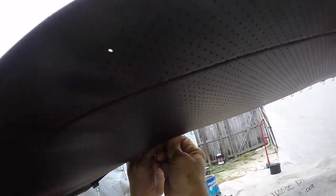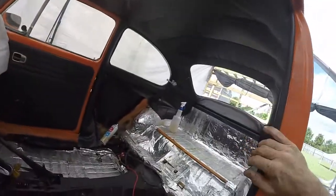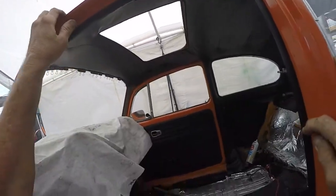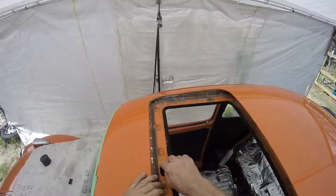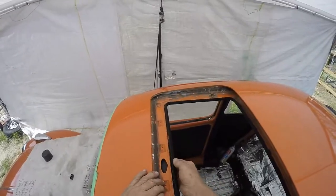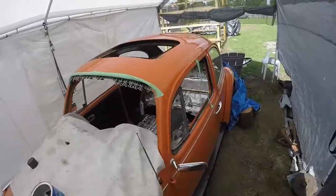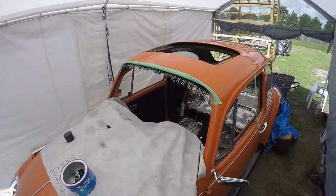Next time, someone else can do the glass — too much for me nowadays. I am really happy with this: dome light in, oh-crap handle in — all right guys, it's all done. That'll tighten up a good amount. I'll come back in here and put all that in to slide the sunroof back in when I finish the panel. For the crank, I'm going to drop it through here, push it up, run the screws through the headliner, touch them up with some black, and the crank will go right over the top. Looks great. That's how you put a headliner into a 1974 Sun Bug.